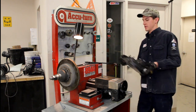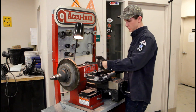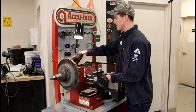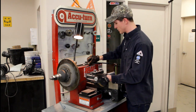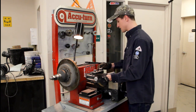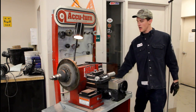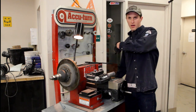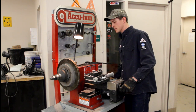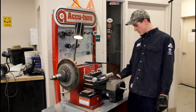We want this reasonably centered up — I realize that's not always going to be possible, but I'll show you the adjustment setup in a little bit. You do need a spacer for the disc cutter, so we'll go ahead and get this lined up with the disc. It's a fairly straightforward process — you've got two cranks, one on each side, and we're just going to bring the lathe over, making sure our locks are off.